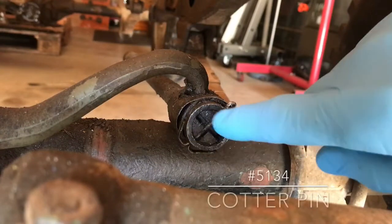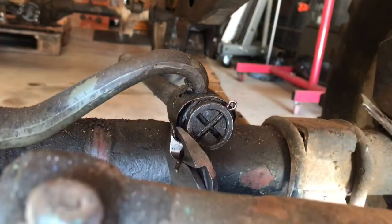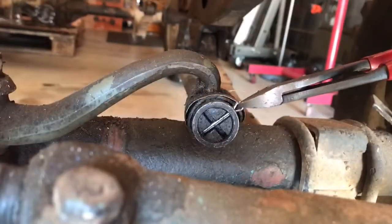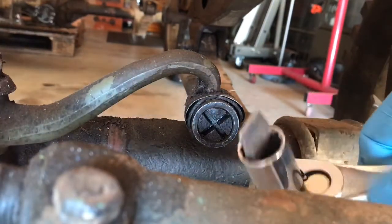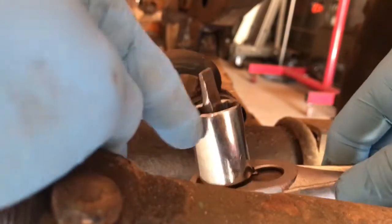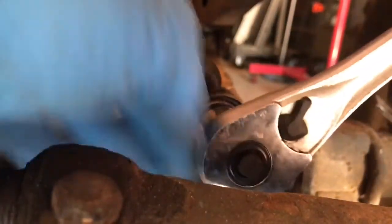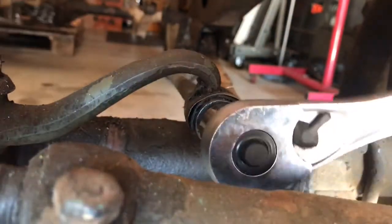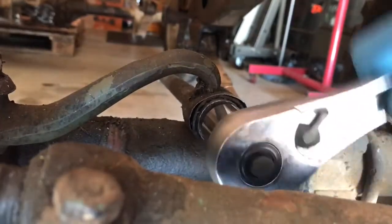I am going to remove the ball plug from the drag link. The first step is to remove the cotter pin. I have created a special socket simply using a piece of flat stock that I welded into the back side of a socket and ground it down to be like a large flat head screwdriver, so I can insert it into the plug and turn it pretty easily. There is a specific tool for this, but this one works perfectly and you can make it easily in your shop.